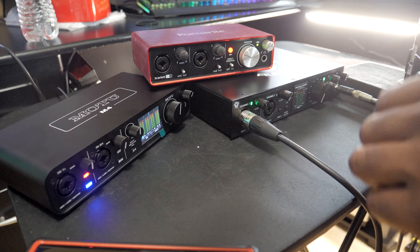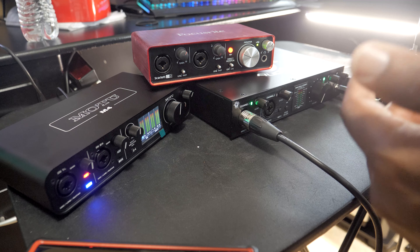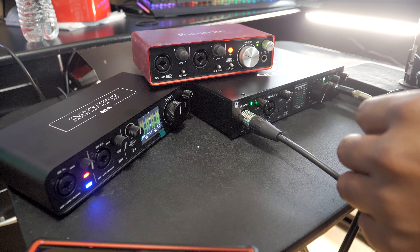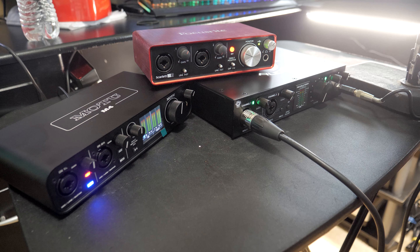Another point to note: I used a regular USB 3.1 port on my computer. I have a Gigabyte motherboard, which has a DAC-up USB port that provides clean, noise-free power delivery to your digital-to-analog converter. Essentially it's a USB port designed to deliver cleaner, lower-noise power to your A-to-D converter, which can make a difference. If you want me to test USB 2.0 vs. 3.1 vs. the DAC-up port for an audible difference in noise floor, let me know in the comments below.